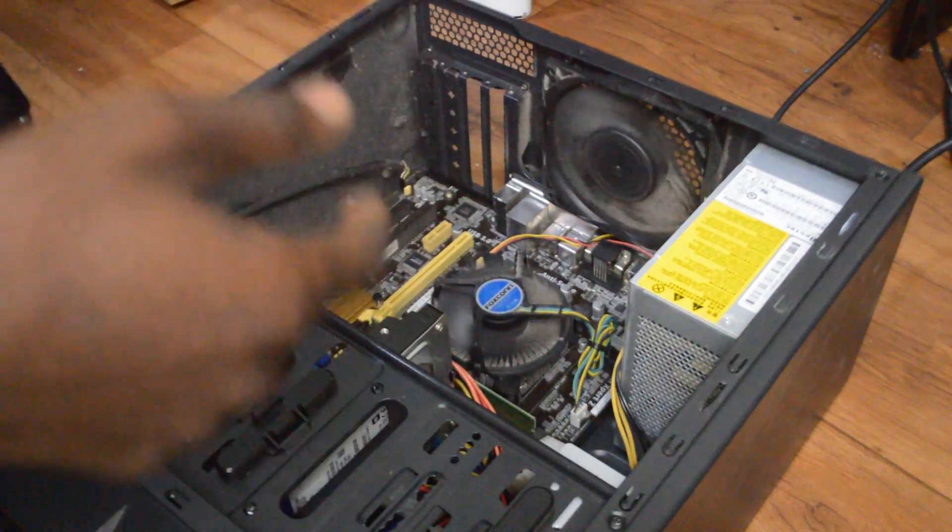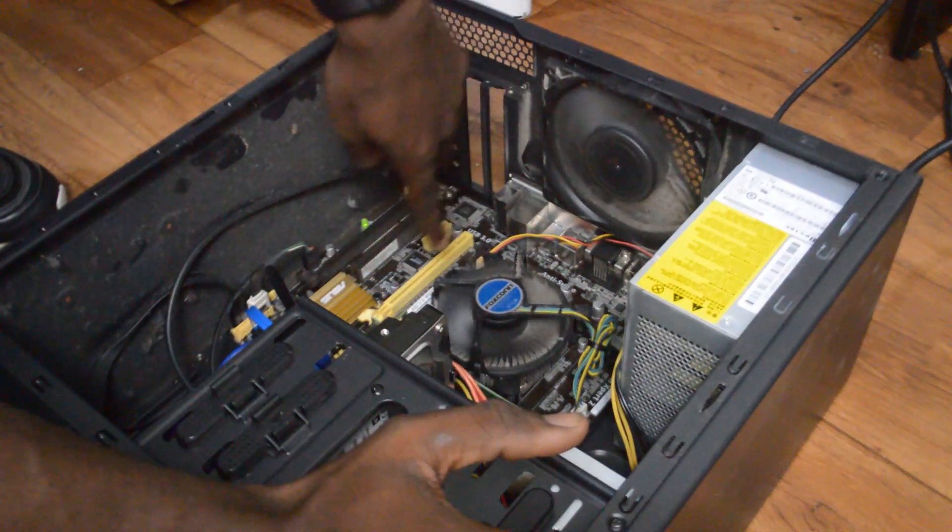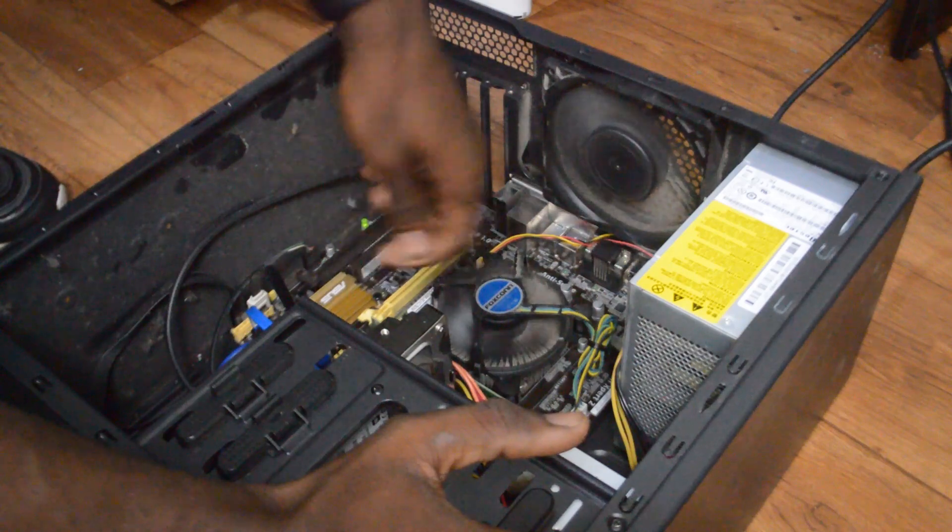This may be a hard drive issue, so let me see if I can find a way to hard reset the computer through a jumper on the internal components. Also, make sure you check the HDMI — if you're using HDMI to output the video feed, try a different port, whether that's a VGA or DVI port. Alternate between ports to see if the port itself is the issue. When troubleshooting, I recommend doing one step at a time.